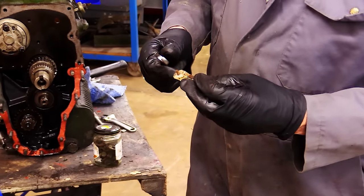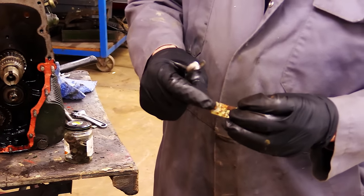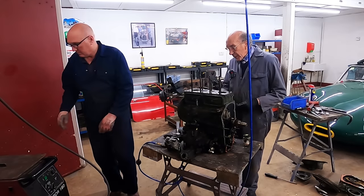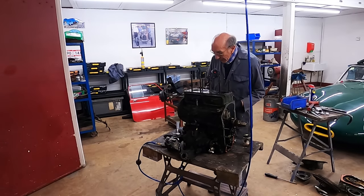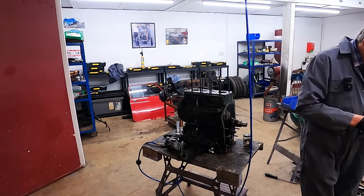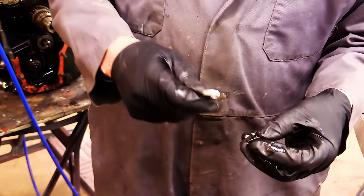And then you just very carefully get those out. So you put a bit of WD on. A bit rotten, isn't it? Yeah. I have drilled them out from underneath, John, and banged them out. So you get your plate off without ruining it. And we've even put this in the lathe, machined that off, and put the original rivets back.